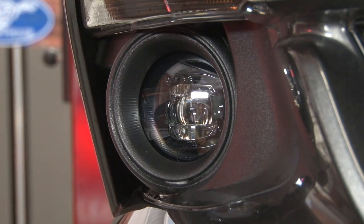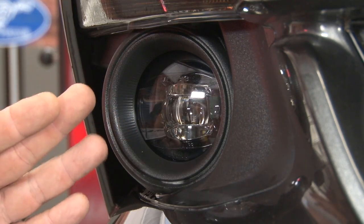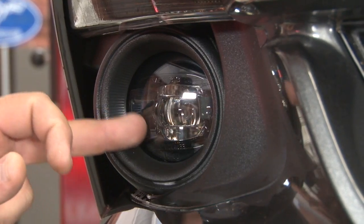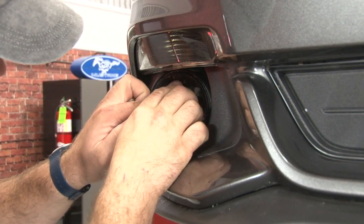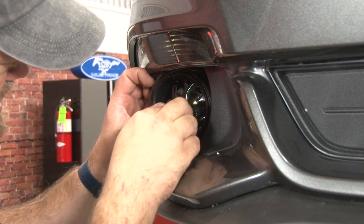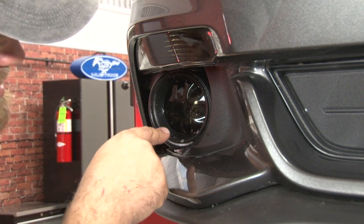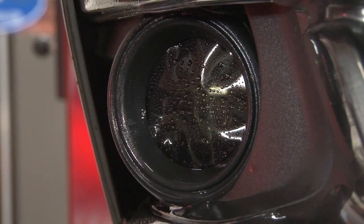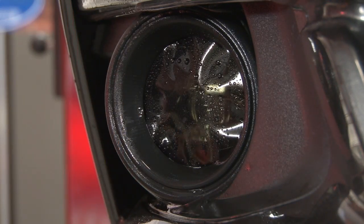Now we can move on to the fog light. We'll tell you there's an easy trick to do the fog light — but there isn't. Because it has a convex shape, you're putting a flat piece of vinyl on it, so you're going to get fingers all the way around the outside edge; you just have to slowly work your way around. The nice thing is once you put the tint on, it'll be behind the plastic ring all the way around, which helps. Start at the bottom and slide it up inside the plastic trim. You'll get bumps all the way to the outside edge, but the front will be somewhat smooth. Make sure the tint is behind the plastic trim. The best approach is to start dead center, get some adhesion by putting heat into the middle, and then work your way to the edges.